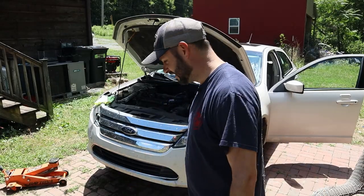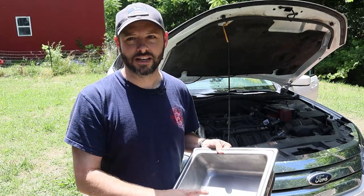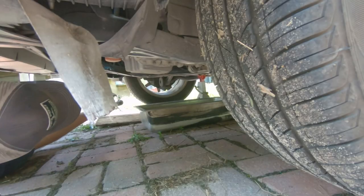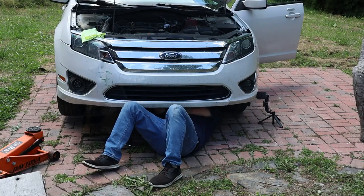There, that's the hard part. Now we just got to put a pan under there. Your oil pan doesn't have to be anything fancy — I've got this old chafing dish. I actually like to use the disposable ones, but all I could find was the small ones. You do want to make sure that it can handle anywhere from four to five quarts of oil depending on your vehicle. When you slide up under here, try to get yourself into a comfortable position and take your phone out of your pocket because you'll end up crushing and breaking it.